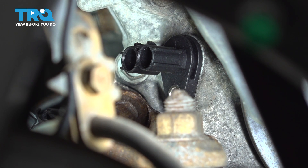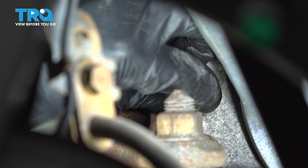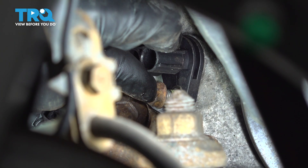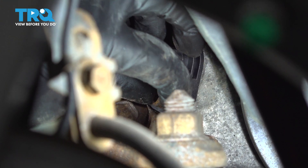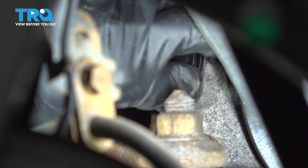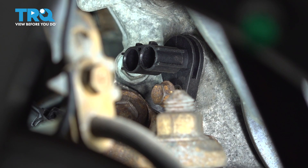Pulling it in with the bolt will usually bend the tab until it breaks off, and obviously that's not good. If it does not go in easily, most likely that means the hole has corrosion in it and you need to clean it out — very carefully so you don't get debris inside the engine. Now let's get the mounting bolt and put it back in. I'm going to put the bolt through and spin it so it drops right into the hole where the threads are. I did feel the threads catch. It still has threadlocker on it, so I'm going to leave that and not add any. If your bolt had to be replaced, I recommend putting a little bit of threadlocker on it — that's what the manufacturer calls for.